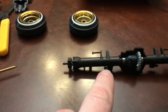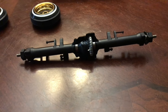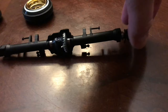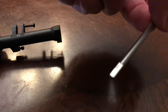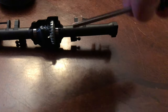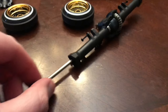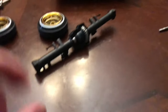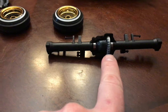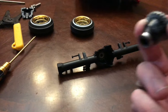I'm going to put the passenger side axle over to the right, and the driver's side I'll put over to the left. That just pretty much pops right out. I wanted to point out it is keyed, so when you put things back together you're going to have to feel around for where that went in the rear diff. This other side is just going to pop right out. So now the rear differential gear should come right out, and that gear is out of the rear end.